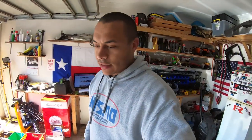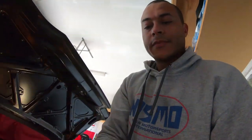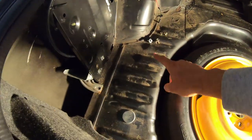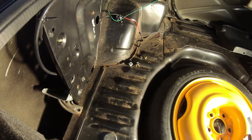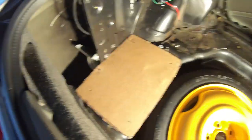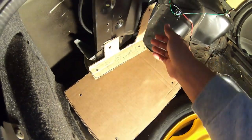How am I gonna mount this thing to the car? Well that's where those cardboard templates came into play. Why would I need to use a cardboard template for a battery relocation? Pretty easy — I like things hidden, and I did not want to cut into my car. I would basically need to drill through the floor and mount my plate then mount the battery back here, and I don't like doing that. So what I've done is basically took some cardboard, laid it down, drew out a template, took that template to a fabricator and got him to cut it out. All this stuff just kind of sits in there all nice and neat — that's basically my bracket for the battery relocation.